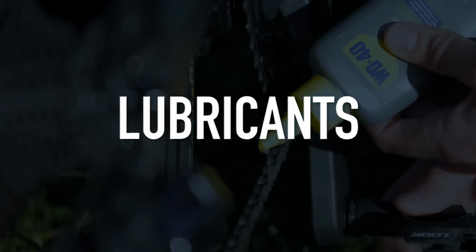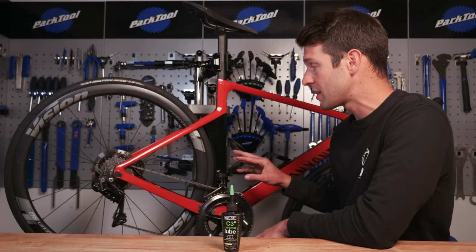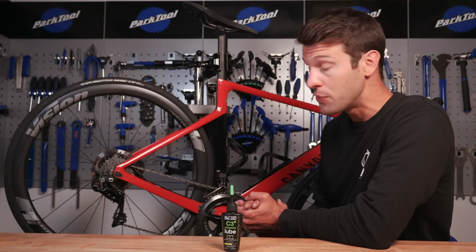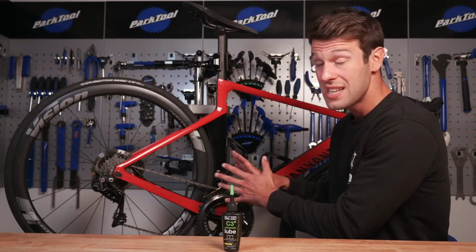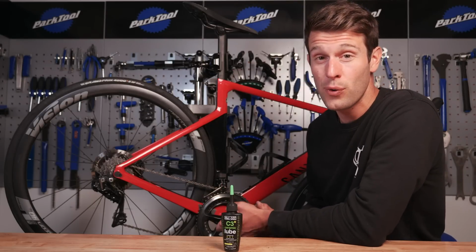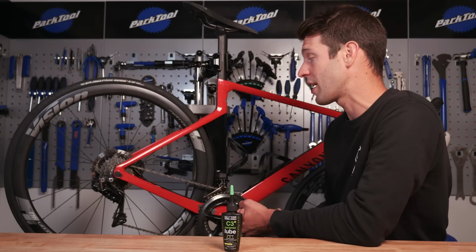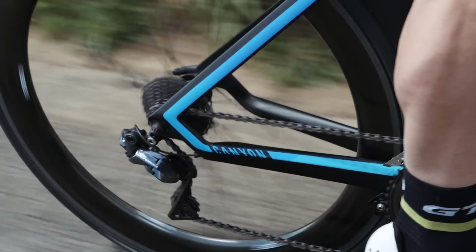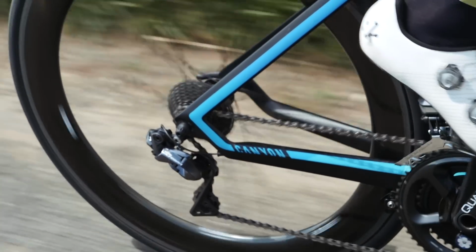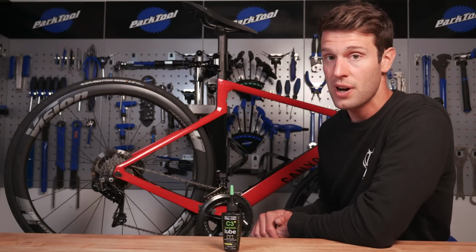Clean that quickly after a ride when you're super tired and feeling lazy, and you get it out looking like new. Right, whilst we're mentioning lubricants, actually your choice of lubricant on your chain can either cost you or save you watts. Now, a typical chain with a 53 tooth chainring setup can have somewhere in the region of 40,000 moving and mechanical parts. So you can start to understand why actually having a clean chain, and a well lubricated chain for that matter, can save you upwards of 5 watts.